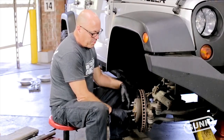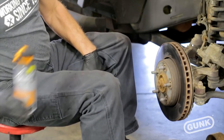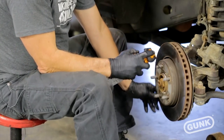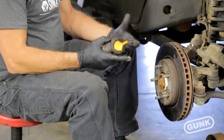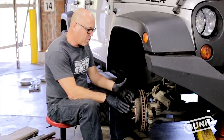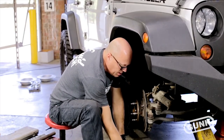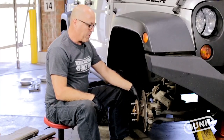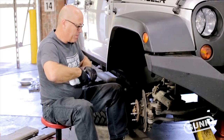This area is exposed to outside weather and there's a little bit of rust on it. It's a fairly close-fit piece, so we can spray a little bit of penetrating oil on there, let it sit for a few minutes — it lubes and penetrates, sucking into those cracks. Then we want to clean everything off really well, and that's where our brake cleaner comes into play.